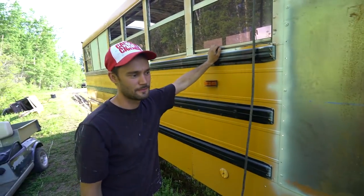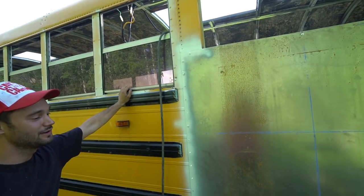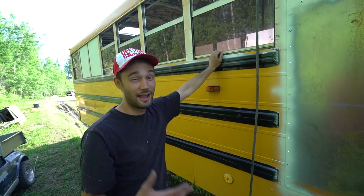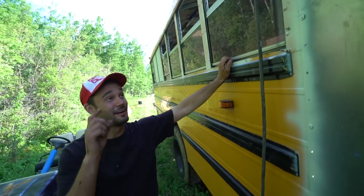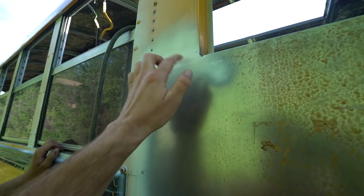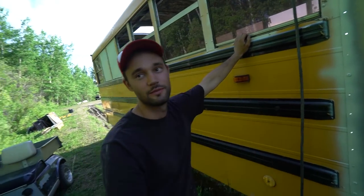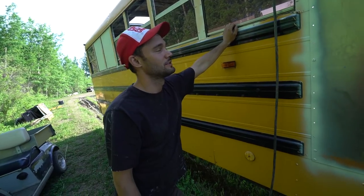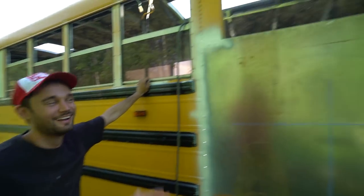Back at the bus checking on Michael. What did we do today? We got the side sheet metal on the bus for the mystery project — which I continually forget if we've revealed or not. Still need to keep welding; the pieces aren't at the same level so I've got to grind them, and then we will Bondo it to make it all smooth. Obviously we closed this side off, but that other side is not going to be closed off — never seen before.